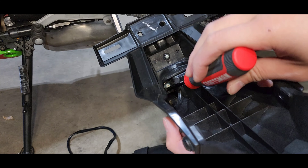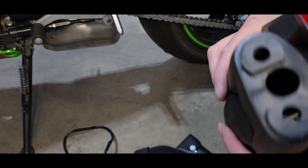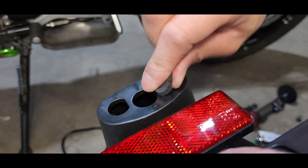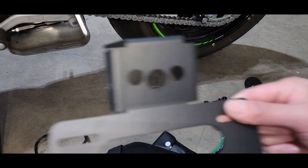The license plate light is just a couple of Phillips heads. With those two Phillips heads out, this license plate light can just come out. There are two rubberized sleeves — I'm assuming we're going to pull these out to fit onto the new fender, that's why everything stays nice, tight, and sealed. Just give them a good pull and they're out.